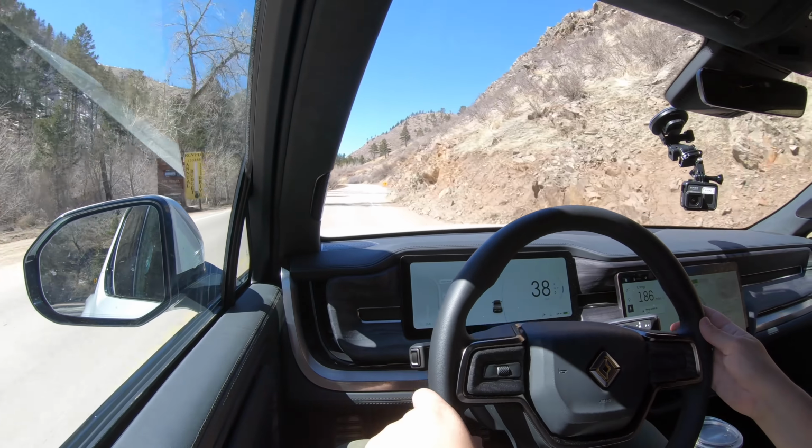I don't know if you saw the steering wheel just do that, but on corners, the lane assistant is too aggressive. So I can go into settings and turn lane keeping assist off, and then it basically just lets me have full control of the wheel. I think because of the undulations in the corners, you can see the truck sometimes misses where the lines are on roads like this, and it's too aggressive in supplying support. Great on the highway though, really good system, although I would like to see a little more leeway, let you get closer to the line before it starts to intervene.